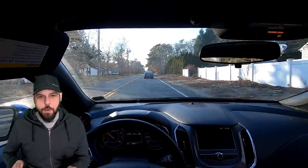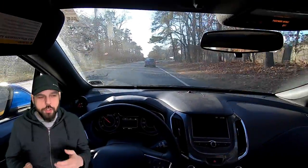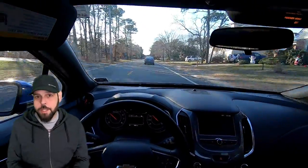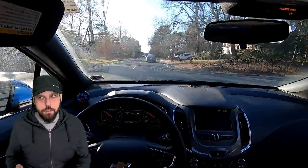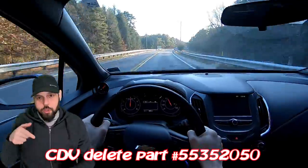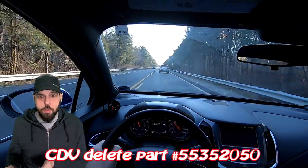I showed how I was doing the clutch delay valve delete because I was in the middle of doing other modifications to my car. I was just curious how you would do it on this car because there was literally no information online, and the information I found was actually incorrect. A lot of people are confusing the generation 1 Cruze with the generation 2 Cruze, and some information doesn't pertain to the generation 2 even though it's supposed to, because they did a lot of design changes. The pipe on my car — that actual elbow — comes with no clutch delay valve in it. I'll display the part number on the bottom of the screen. When you saw me drilling the hole through the one I had, it had the clutch delay valve in it — I drilled the hole out — so basically what I did was create that same part from my factory part. It's a free modification.